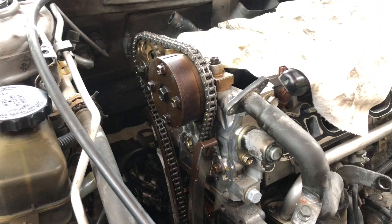Hey, what's going on everyone. If you're working on the 2ZZ engine and you're having a hard time taking out the timing cover, what I did — I obviously removed the motor mount that's on by the alternator on the passenger side, and also the motor mount that's by the radiator in the front of the engine.